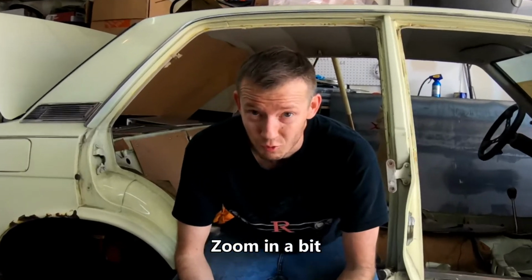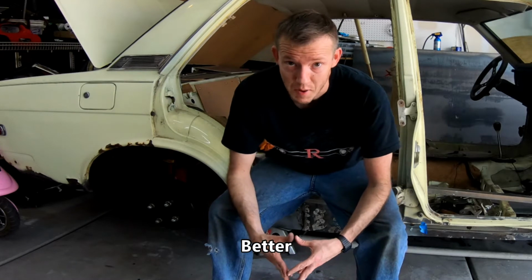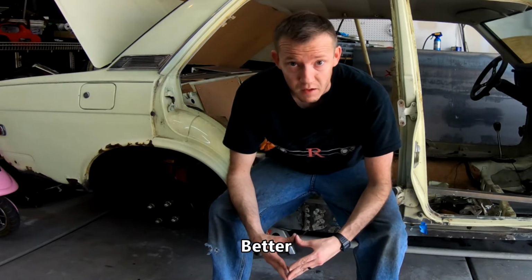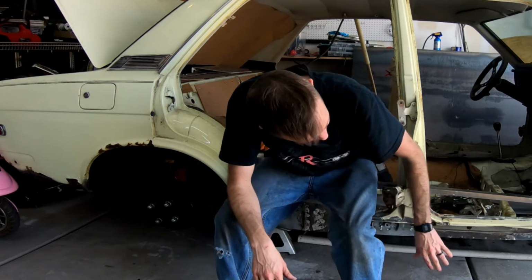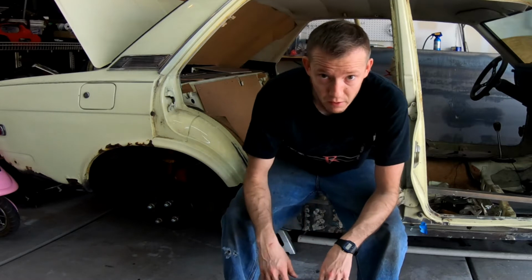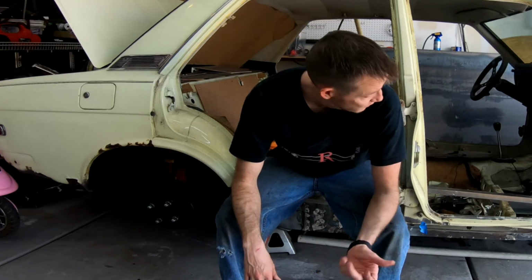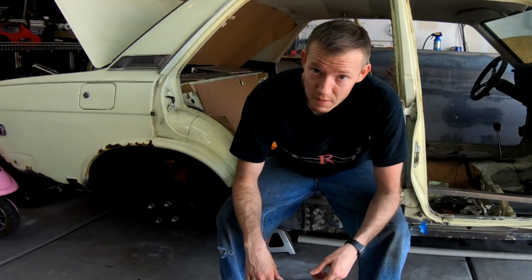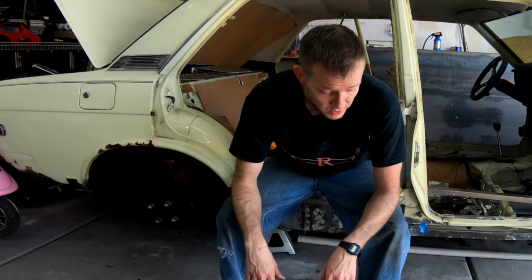Well, some of those welds are anything but pretty, but grinder and paint makes me the welder I ain't, right? So I have got this rear section tied into the inner sill. The inner sill is now complete. I have one more wraparound piece to make here for the back portion before I'm completely done with that. I've started welding in the rear floorboard, and then I'll go back and do the front floorboard after that. All in all, it is going together pretty well, though slowly.